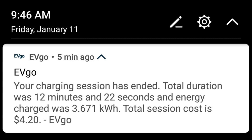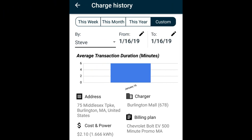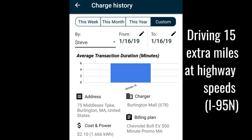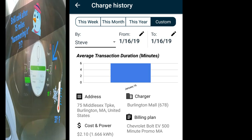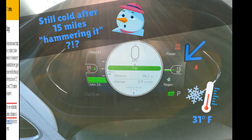That wasn't a successful experiment, but we can at least say that any small amount of highway driving is not going to help you get that battery warmed up for a higher charge rate. You're definitely going to need more extended highway driving — maybe two or three exits would make a difference. The further you go on a highway at high speeds, the further away you have to go from your charging destination. The far preferable option is to have a level 2 for your DC fast charging sessions and make sure you're planning those out after one or two hours of driving, because you do not want to be trying to fill your battery when it's cold.